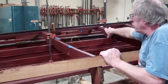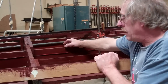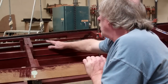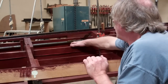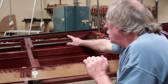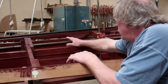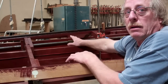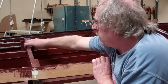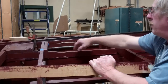This first bay I'm just going to put in with a notched-out frame. This middle one I'm not really sure what I can do with, so I'm going to make it a little extra thick and just float it out in the middle — that will help support the bottom planking along with it being hooked into the keel. We'll drill a hole and bolt it through the keel if we can get close enough, but the transmission area is right there, so that one might be floating, double thickness. This back bay I believe we can go right back to having a good frame on it.